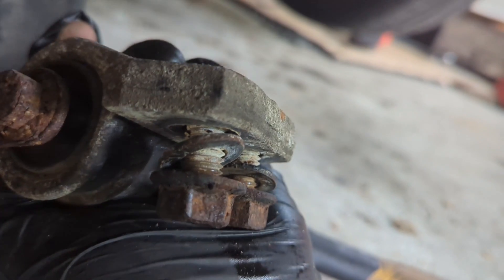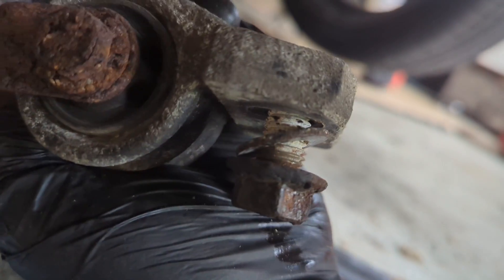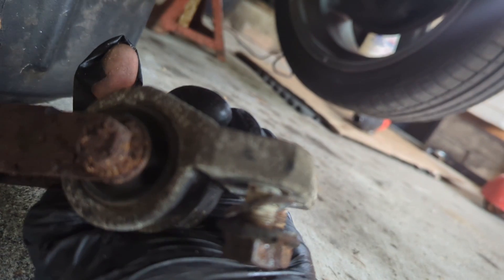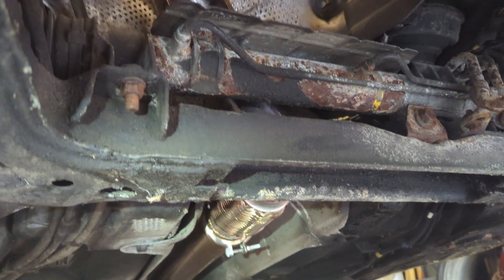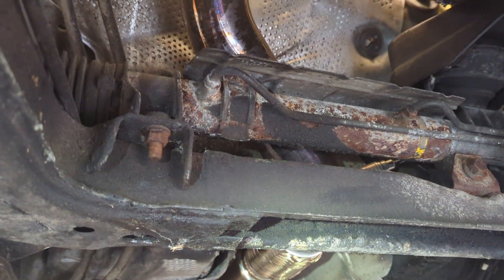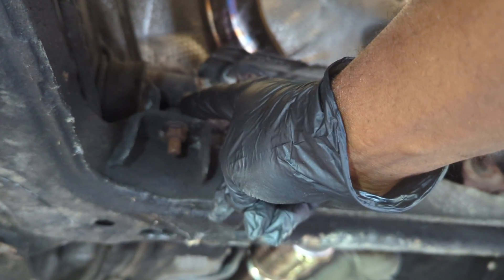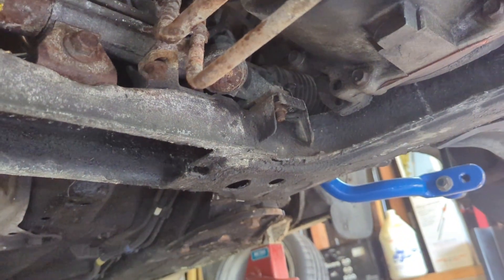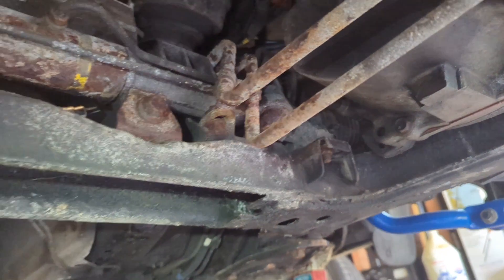Just a reminder that these transmission torque mount bolts normally have washers on them — I saw one yesterday that didn't. I'm going to drop the subframe and push it under the car. I'm going to take this steering rack loose from the subframe. Remember, do not hit these bolts with impacts because it loosens the cast nuts on top of them. I got a few 15 nuts and an 18 nut, and this steering rack will be loose from the subframe.